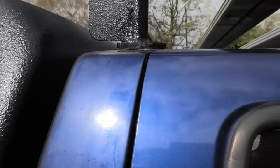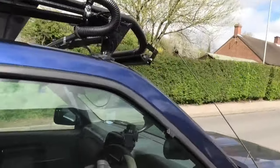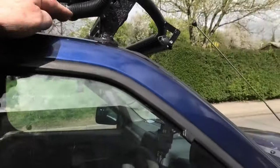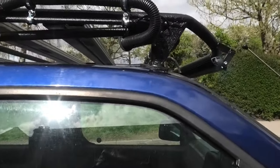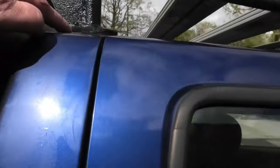I want to put a little bit of fairy liquid or something on the body of the vehicle because I don't want the sealant sticking to it. But it has to be said it isn't leaking, so it's not really essential — it just looks untidy because it's not mated up to the roof properly since I've got the angle slightly off. It wasn't an easy thing to do, I tried my best. If this was removed again I could hit that with a hammer and fold it just enough to tuck it in, but if I try that now it'll chip the paint and probably dent the roof, so we're not going to do that. We'll take up the slack with some sealer.